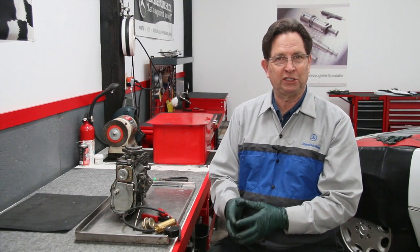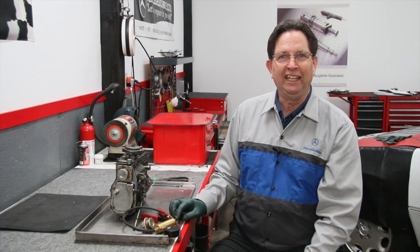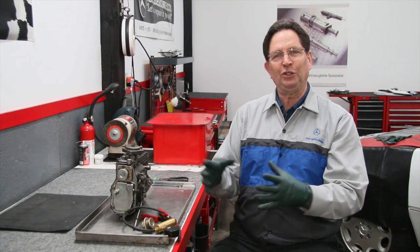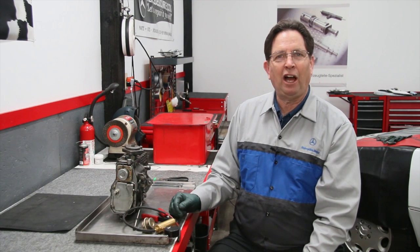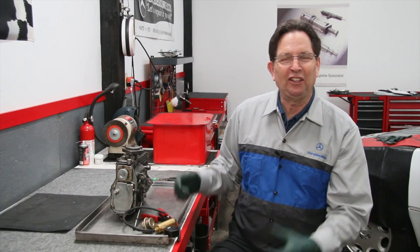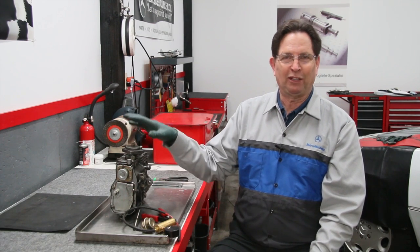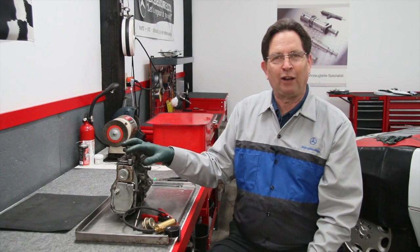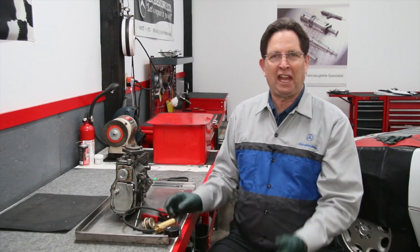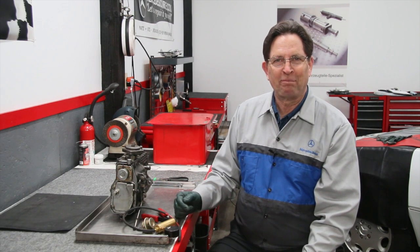As a parting shot, I don't want to criticize anyone who doesn't know why a Mercedes diesel shuts off, because I've been there. I can still remember — this was over 20 years ago. I got an 82 240D and did the first oil change on it. I thought, wow, this is really cool. When I went to drive the car and came back, I went to shut it off and it wouldn't shut off. I was like, what's wrong? So I've been there — I know the feeling of why won't this engine shut off. What I had done is a very common problem: I knocked off the vacuum hose when I changed the oil filter. I did a little research and found out there's a vacuum hose there that goes to the shutoff. That's part of the learning curve, and that's what we want to do in this whole series on owning and maintaining an old Mercedes diesel. I hope you enjoyed this video.